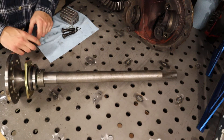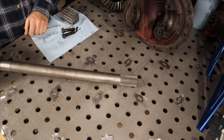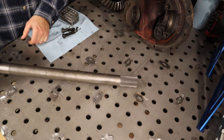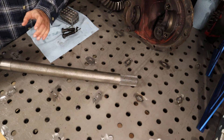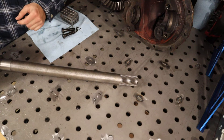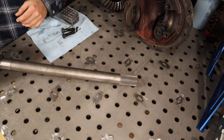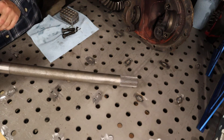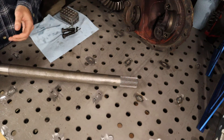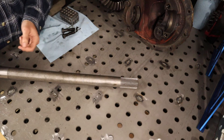What I really want to talk about is the splineage on these cut-to-fits. If you run a narrowed axle like I do, you might need cut-to-fit axle shafts. The benefit is that even if you cut nine and a quarter inches off or something like that, they can make it work. You cut the right length and you'll be good — you don't have to get an exact measurement or pay a really handsome fee to get custom ones made.